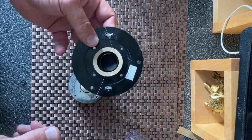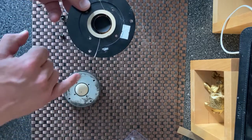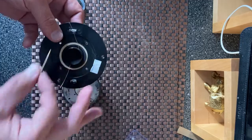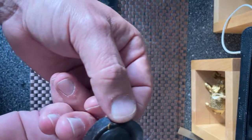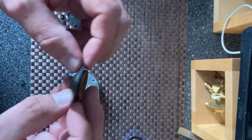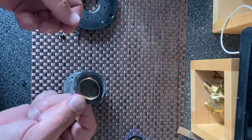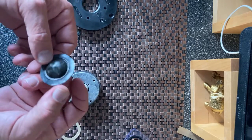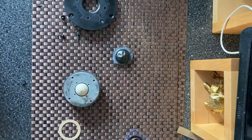You'd end up with that, and then with the magnet back on top you make sure you isolate just with two thin strips of black tape so the wires can't touch onto the magnet face plate, and you're all good - that will work. That's far less fiddly than having to poke holes through the diaphragm, run the lead wires up through to the face plate, and then apply some sort of glue over the lead wires to seal them in. In my opinion the HF-1000 is a pretty fragile HF unit - the HF-1001 is far stronger. In terms of sonic characteristics I won't comment on which is the better of the two, but yeah, these are pretty fragile and easily blown.